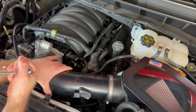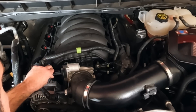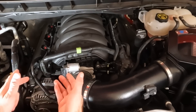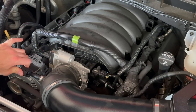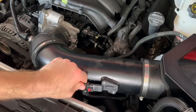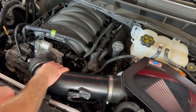Give it a nice pull and make sure everything is secure. Now let's move on to plugging this clip in — take this clip and normally slide it back on, and then you would take that gray piece that broke and clip it back in, but we don't have that option anymore. With this new connection I was going to put some tape around here, but it's pretty snug so I think it's going to be fine. Go ahead and connect your PCV hose. Then connect the mass airflow sensor plug — click that in and push that red tab straight. Everything looks pretty good lined back up and secure.